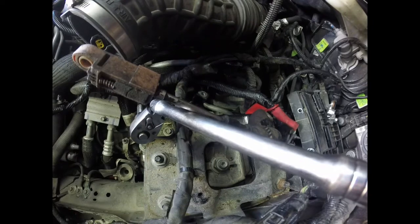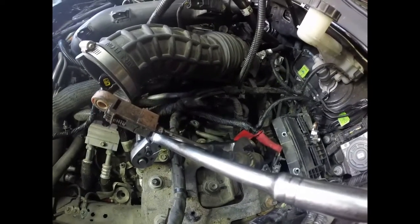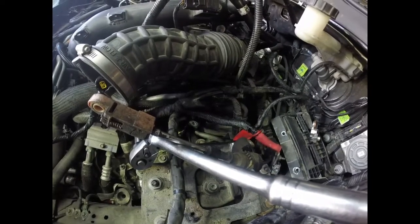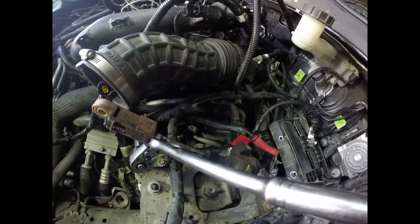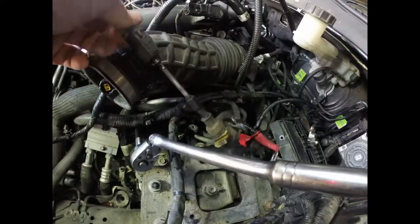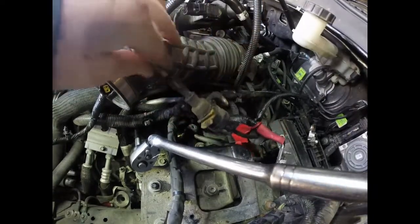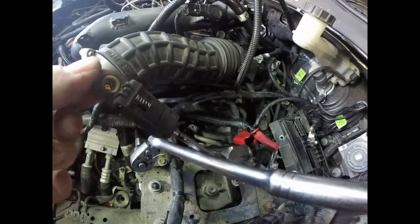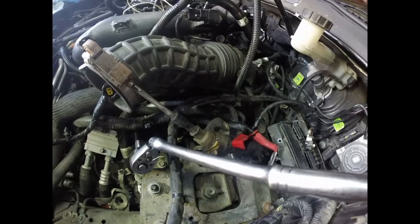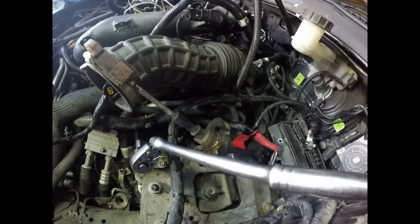The first thing we are going to do is put the shifter cable back together. Since I have already got this out we have to go in reverse, so I am just going to give you an overview of what to do. Here is my shifter cable — it is held on by a 10mm bolt and it snaps in. This plastic piece snaps into the bracket and then this just pushes in and out off of the shifter lever on the transmission. I am going to install it and show you after I am done.